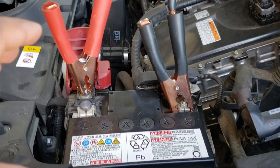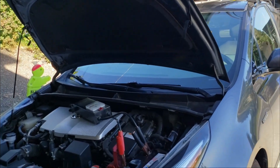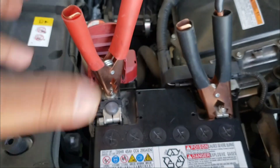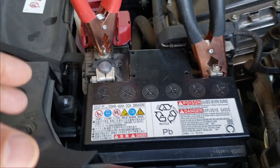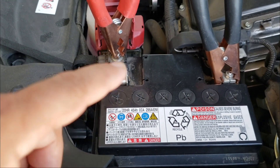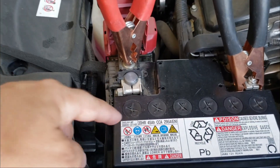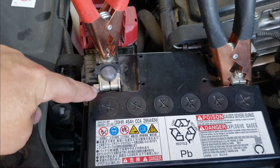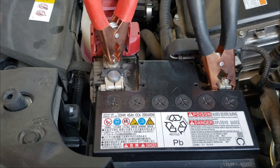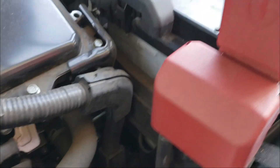This is my 2016 Toyota hybrid. It uses the 12-volt battery to power up the electronics — not the engine, but most electronics. This 12-volt battery is essential in 99.9% of vehicles. Sometimes we get lucky where these batteries can actually be serviced. What happens is the fluid inside gets overheated from weather or from charging, and some of the water evaporates.